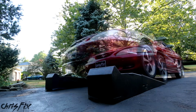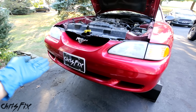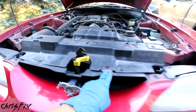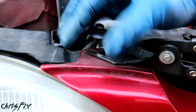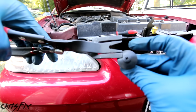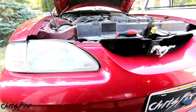So let's get the car up on ramps so it's easier to work on the front bumper. Now removing the front bumper cover on a Mustang is pretty simple. There's a couple of plastic clips up here that need to be removed, and anytime you remove clips like this, I highly suggest using a panel clip pliers. These things are lifesavers. They don't damage the clips, so you could reuse them, they just pop right out, and I'll leave a link to these in the description for you.